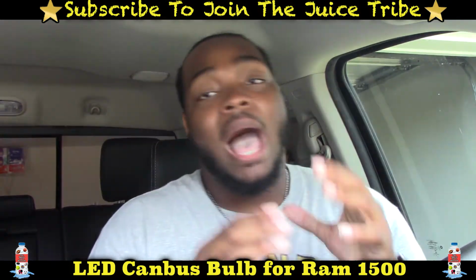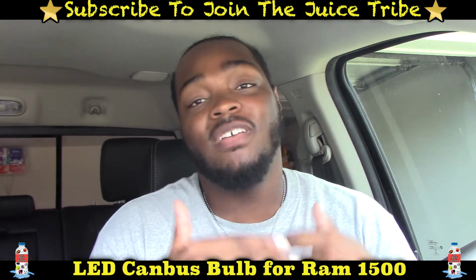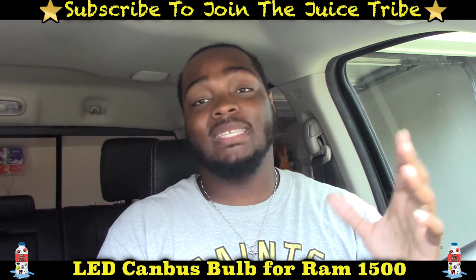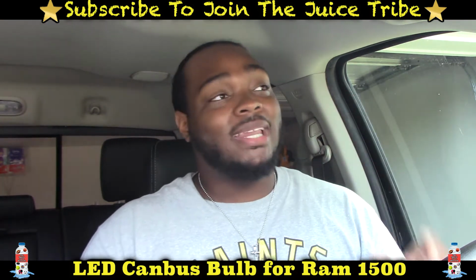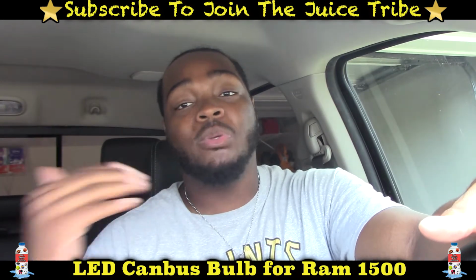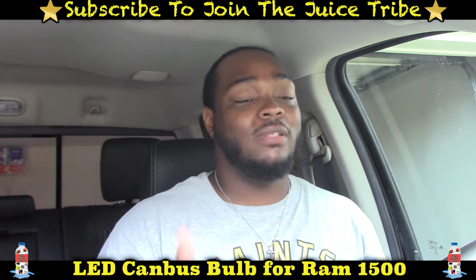So today, I'm going to be testing out some LED reverse light bulbs for my Ram 1500. Anyone who has a Ram, I believe 2015 and up or 2016 and up, we all know the system sucks when it comes to LED bulbs. If you put anything LED related in your truck, you will get an error message code on the dash, and it will be like error bulb out when the bulb is really on. The reason being, LED lights don't put out a high frequency like the halogen bulbs do, and it just causes the system to feel like there's nothing there.